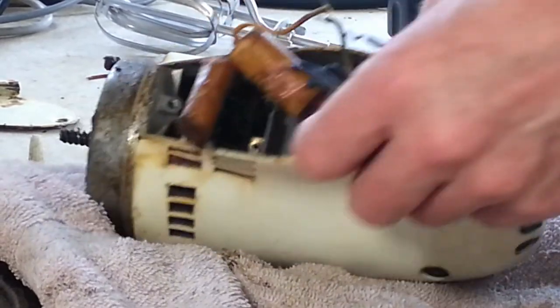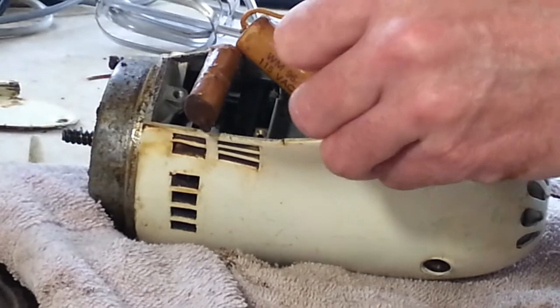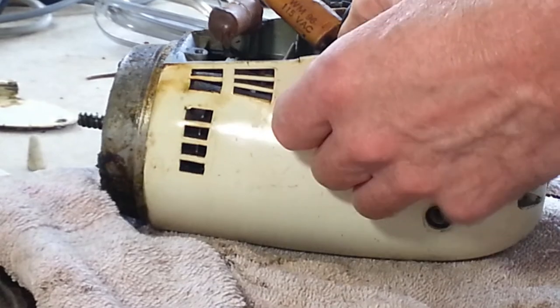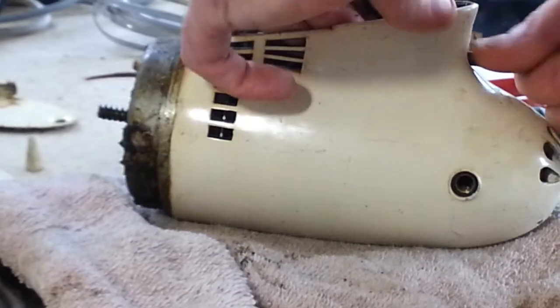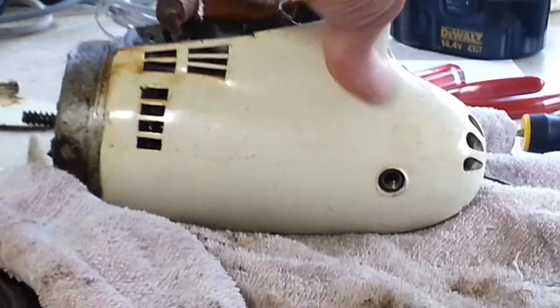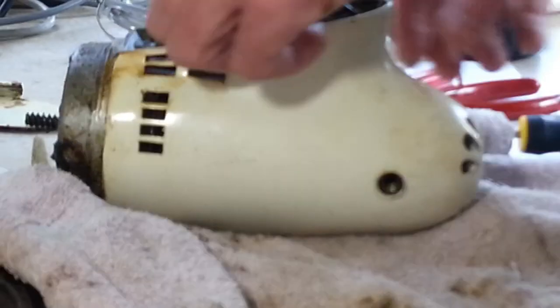But if you wrap your cord, we bring your cord in, even the new round ones, what we do is we bring them in, wrap it around there, and then when the cover goes on, it'll keep that from coming out. It puts enough bends in it to where you can't pull your cord out the back. And there, now we got that cord out. Then go ahead and go into the old cord pile.